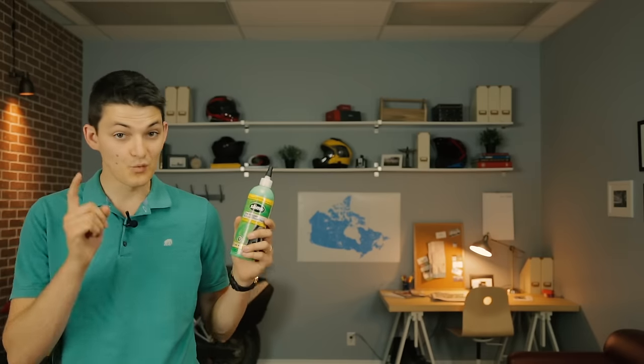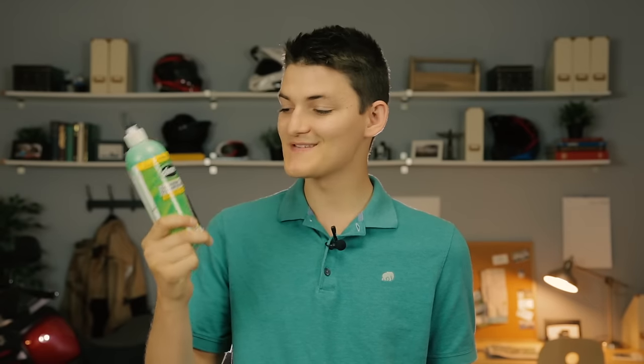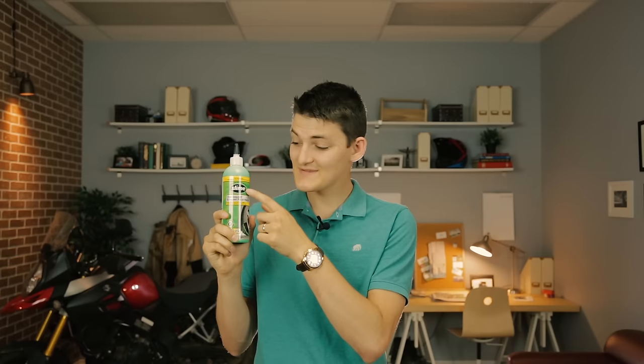There's even some protection from catastrophic punctures, like if you run over a railroad spike. Slime won't completely fill a hole that size, but it will take a lot longer to exit your tire than the air, so it'll slow the deflation down — and that can make the difference between getting safely to the side of the road or losing control. Now, this particular tire sealant is not the one I'd choose. Slime stays liquid, so when you go to swap your tires it makes a bloody mess, and some mechanics straight up refuse to work on tires that have slime in them. On the other hand, there's a brand called Ride On, which makes a tire sealant that turns into a semi-solid gel, so it doesn't leak everywhere when you remove the tire, and it has the added benefit of balancing the wheel. Most importantly, Ride On is kosher for high-speed motorcycle use. So I'd take Ride On over this green stuff.